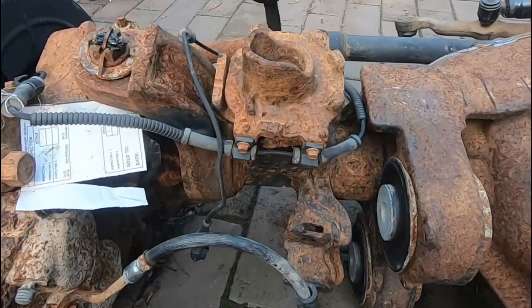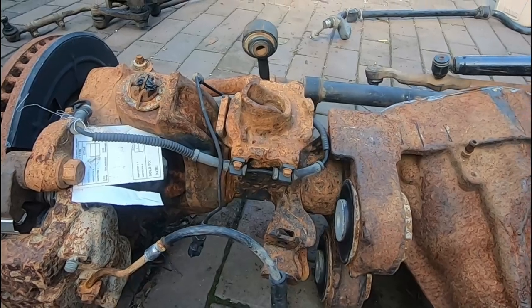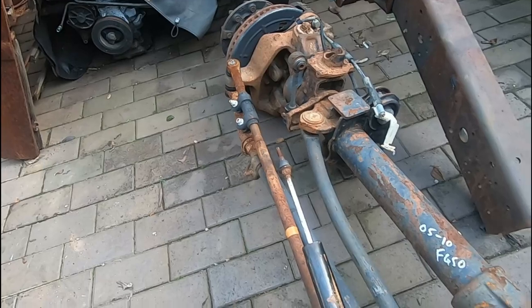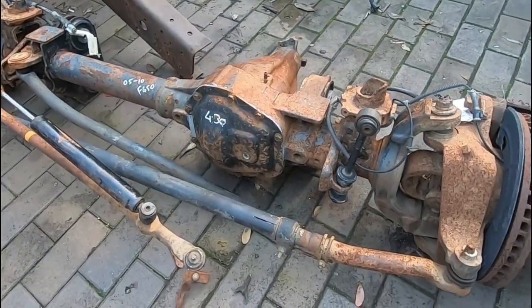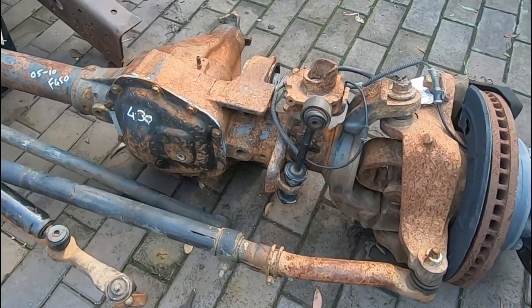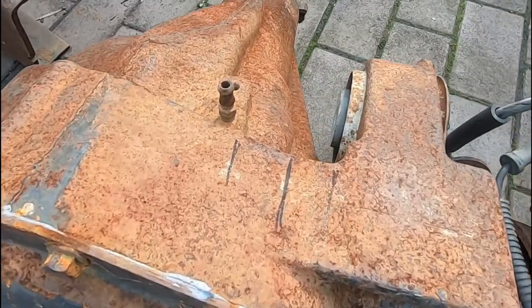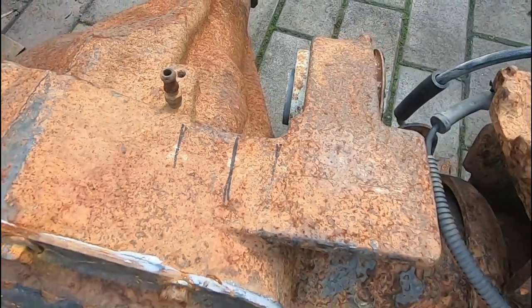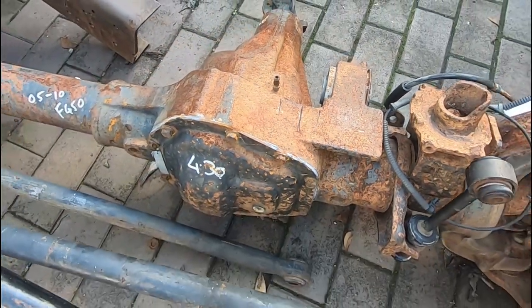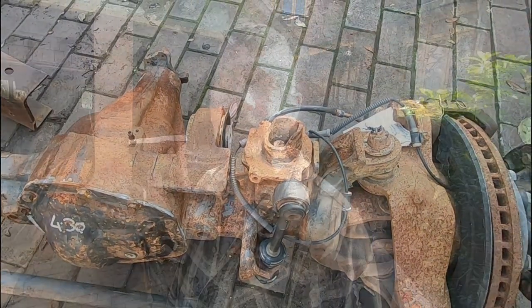This front diff is also a coil front suspension, and we're going to look at actually modifying the truck to retain that system, which will hopefully assist us with this front steering system, because we would have had difficulty clearing the leaf springs, and of course we would have had difficulty mounting it as well, because this is in fact, at these marks here, exactly in line with where the springs go on the 35 truck. Very far removed from the original mounting system.